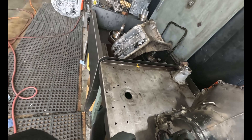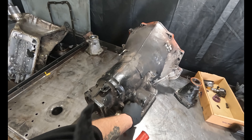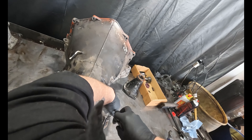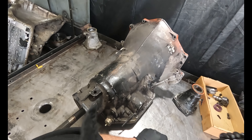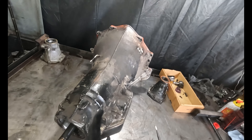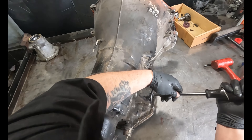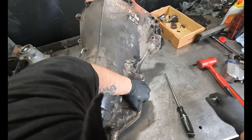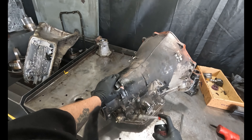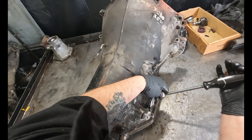Might knock the clip off of there. Let's get the accumulator snap ring off of here — and maybe the spring. Sometimes these can be a little bit of a bitch. All the goo crap is stuck in there holding it in. It's just an O-ring in there, kind of like a press-fit O-ring. There it is.